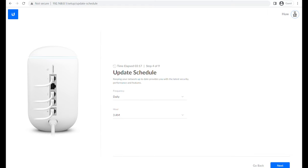Sorry, that took a little longer — I've got two-step verification set up so I needed the app to get through the login. You can set that up through your Ubiquiti account. If you don't want to use your Ubiquiti account at all, you can press skip and just give the router a local password — the disadvantage is that it'll be local access only, but you can come back and set up the account later. It then asks for an update schedule; it's usually best to leave it as daily, though you can change this if you're worried about updates causing issues.